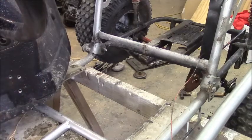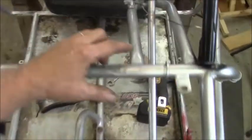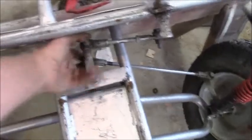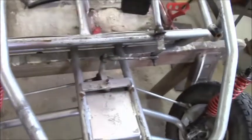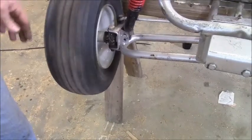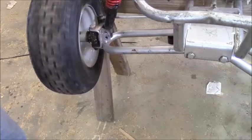This must have been sitting out in the rain because there's water running out of it, but it'll eventually all run out. I need to grind these welds off the steering column and just recenter it, and get this whole crappy assembly out of there and put those two heim joints directly on the steering column — that might be all I need to do with the steering for right now, and that'll really tighten it up. The bearings on these shafts are loose as hell. I don't know how to fix that. I like the size of the tires and they've got good tread — I don't know if I need to get new spindles or figure out what's wrong.